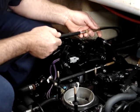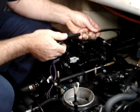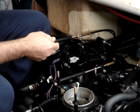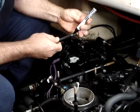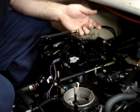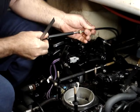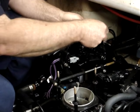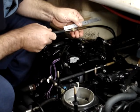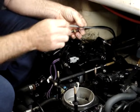The specification for the maximum amount of movement on the cable is 9/16ths of an inch or 14mm. We check that by pushing all the way in on the cable in forward gear, marking the cable, then pulling out on the cable to check for movement — don't pull too hard or you'll pull it out of gear, just take the movement out. We then measure that. This drive is showing 3/8ths of an inch, 10mm, so we're within specifications.